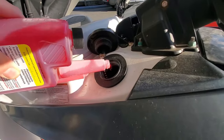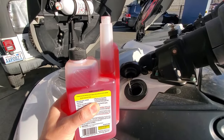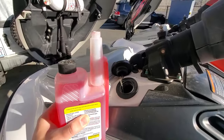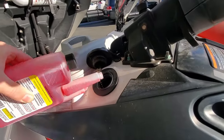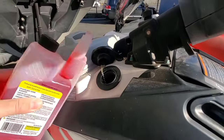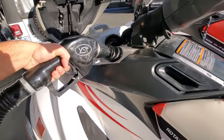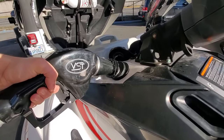We're going to do six and a half ounces — check your owner's manual or search online to see what size gas tank you have for your personal watercraft. It's always good to put in fresh gas and pour the stabilizer in first so when you pour the fresh gas in it will mix. I always use premium because I have a supercharged model, but I always recommend premium for all personal watercrafts — it just makes the engines run a little bit better. So fill her on up.